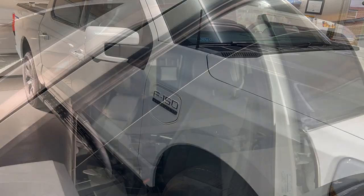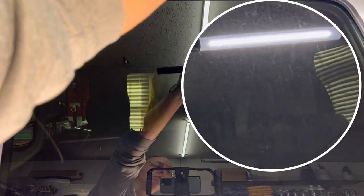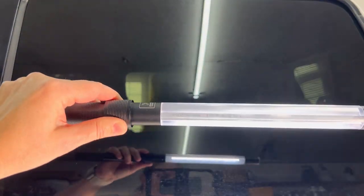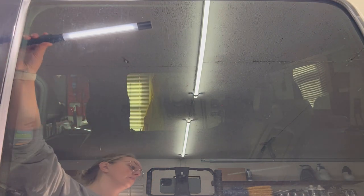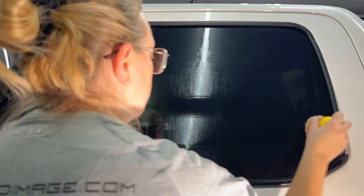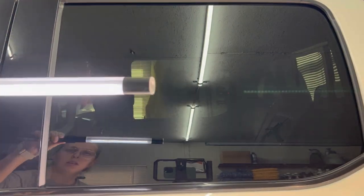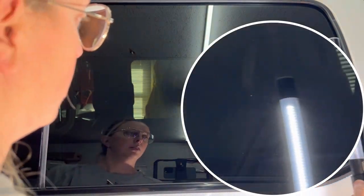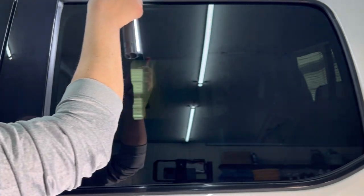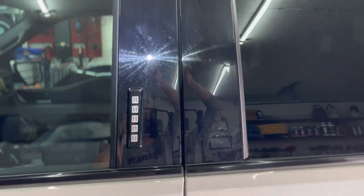Now we're going to prep our glass for the glass coating. First we cleaned the glass inside and out with Invisible Glass. Even after cleaning we still had water staining — acid-based water spot removers didn't make a dent, so we stepped it up and used a glass polish. One of my favorites is Pinnacle Water Spot Remover. Using a 3-inch Lake Country purple wool pad and some of that solution, we massage it in, go over with a wet microfiber, remove the residue, clean again with Invisible Glass, and now we can proceed with applying the Invisible Glass ceramic coating.